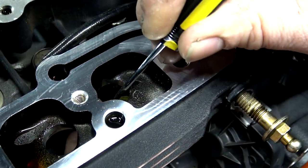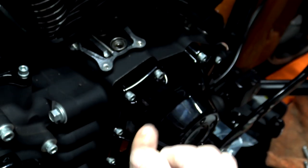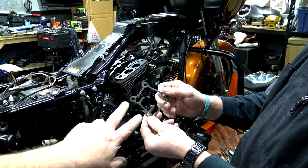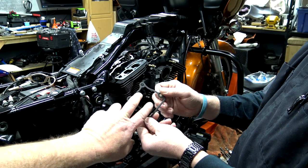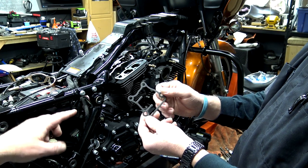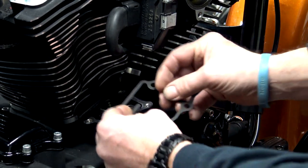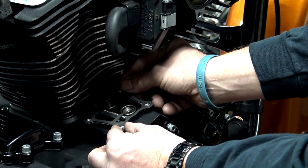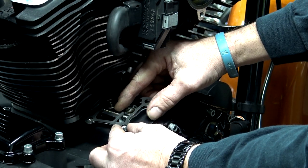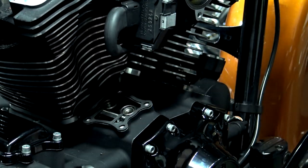You've got several O-rings on your tubes and then a couple down here on the lifters. On your gaskets, you have these two things called the ribs. When you put it on, make sure that it's covering the anti-roll pin — you can see those ribs are going to cover the anti-roll pin going across there. That's the correct way to install the gasket. Both of these gaskets are marked rear and front — there's an R inside this one, so we know that's the one we're working on.